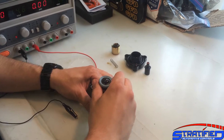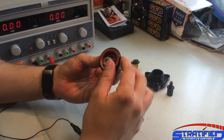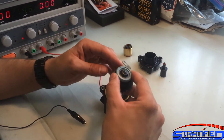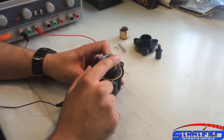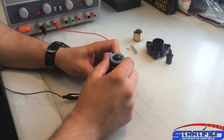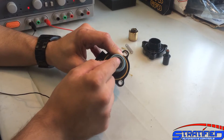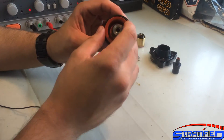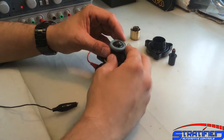This is a REV G valve and it's got a diaphragm here - this one actually doesn't have a damaged diaphragm but it was leaking under boost, you could hear it. When the valve is supposed to hold boost it's in this position, and this surface of the valve seals against the high pressure side. Underneath, when it moves, is the low pressure side. This disc seals against the compressor housing, and boost builds up inside this diaphragm through these holes - it's not just a return spring that prevents it from opening, it's actually boost that builds inside this larger surface area that seals it shut.